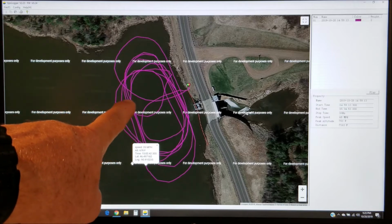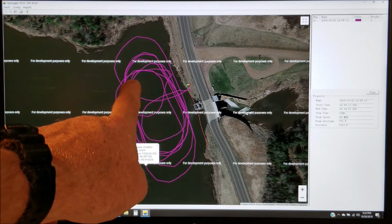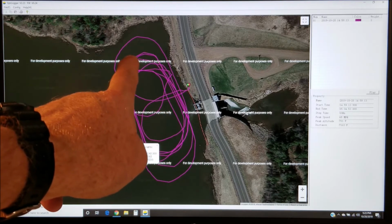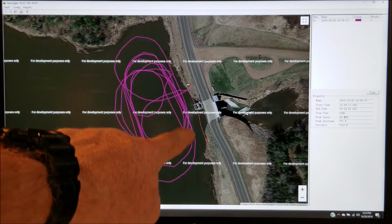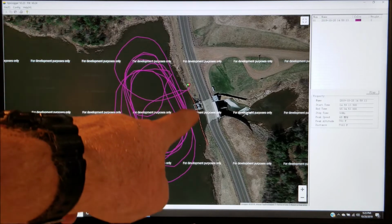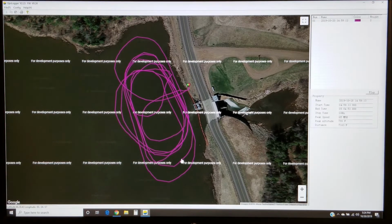So I changed it to 70, my other drive mode, which was just set at 75%. I could feel I had to steer it through the turn. That could be the hooking, but if I gave a full turn on the steering wheel, it would oversteer on the corners. So I'd be curious to see how uniform a turn is with the steering dual rate set up right, where you commit to make a full turn, and also how the speed would hold through the turn.